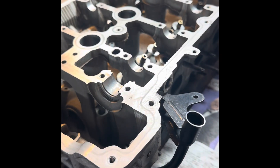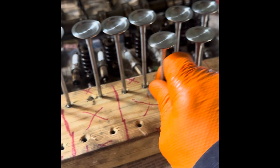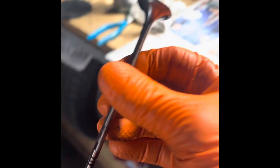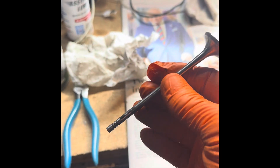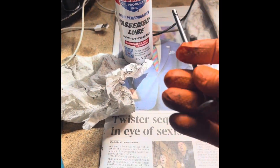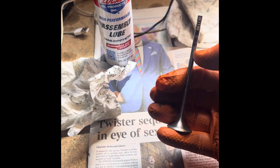Alright, let me turn this over on its side. We'll put this valve in - this is one from the exhausts. So what we're going to do first is take the exhaust valve, it's already been cleaned but I'll double check - I'll spray it with brake cleaner, clean that up, wipe it down. Then I'm going to put a little bit of assembly lube on the stem. You want somewhere completely clean - what I like to use is lots of newspapers on here, because if it gets dirty I can pull one off and it's clean underneath with no dust or anything.